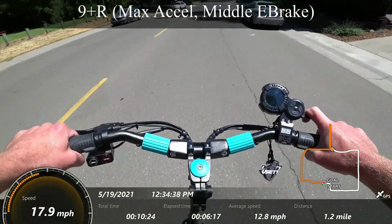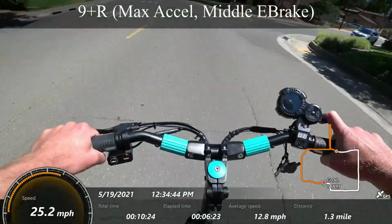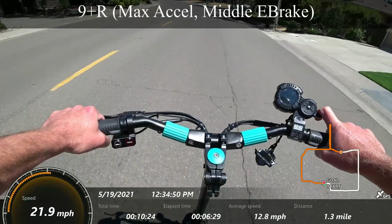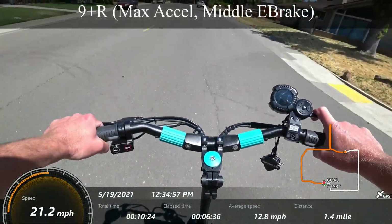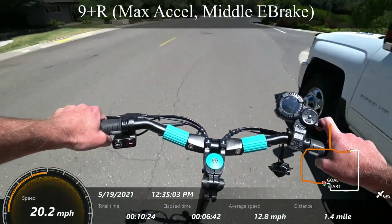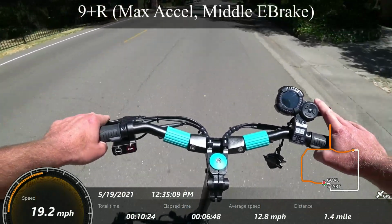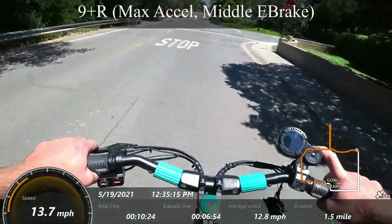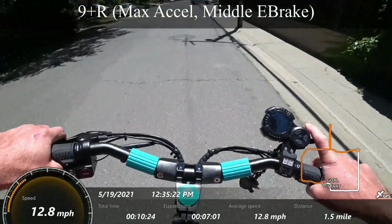And again, I'm going to hit this speed bump up here with some speed. So that's where I could sense that 8.5-inch tire a little bit. On the entry to that particular bump, it was a little abrupt. And you know, the smaller diameter tires just don't roll over some stuff that larger diameter tires would. It's just a fact of the matter. You end up with a smaller form factor and typically lighter weight, but it's always a give and take with electric scooters with pretty much any feature on them, and tires are maybe the most pronounced of that.